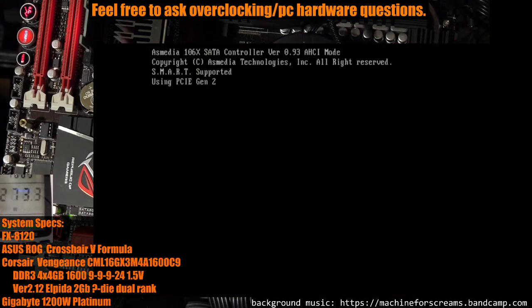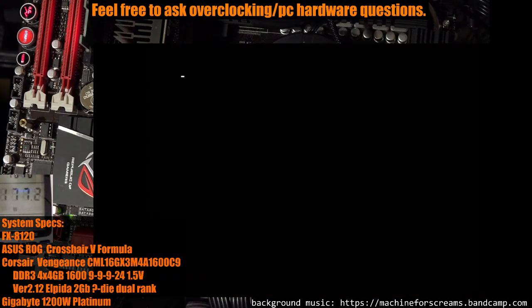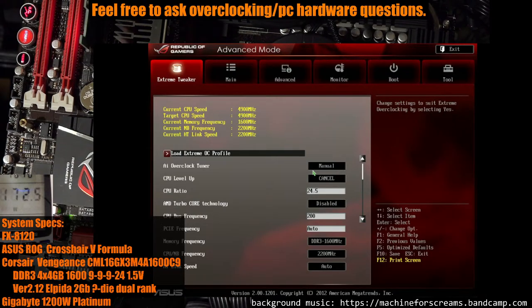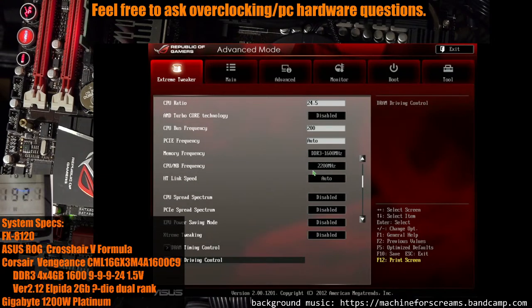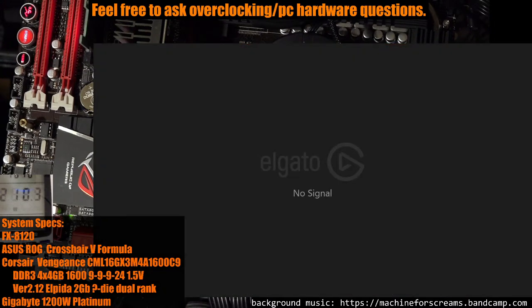As far as I'm concerned, the 32 nanometer AMD CPUs for V-Core are borderline indestructible. Though that's not entirely true, I have actually managed to kill one, when I accidentally booted a CPU at 2.1 volts at minus 20 degrees Celsius. 2.1 volts at like minus 180? Fine. At minus 20? Not fine. Very not fine. CPU was literal insta-dead. It might have been 2.2. It was definitely over 2 volts.